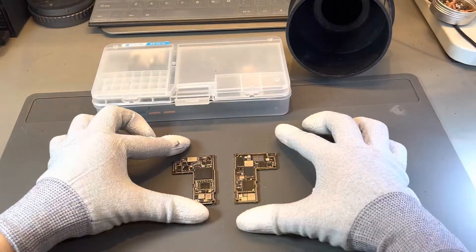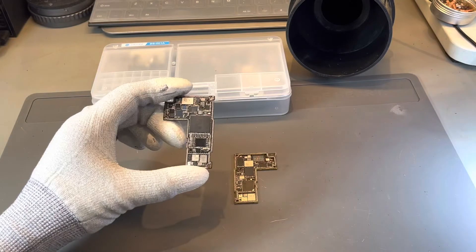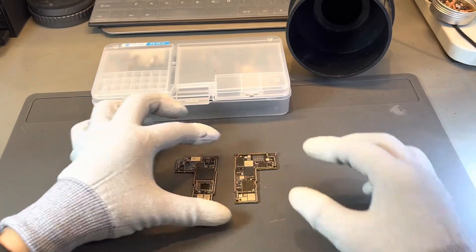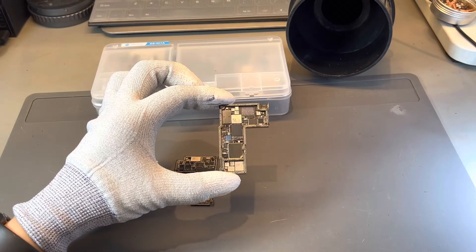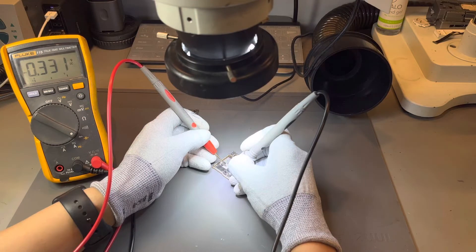This is what the two layers of the board look like. The top layer is where all the processing happens. The largest chip with the largest surface area on that top board is Apple's A14 Bionic chip. The bottom board is where all the radio frequency microchips sit — this is the connectivity to Wi-Fi and Bluetooth, and the connectivity to your networks, and that's what we needed to further inspect.